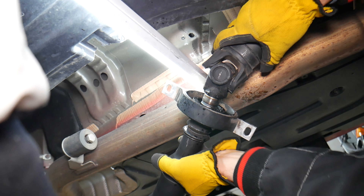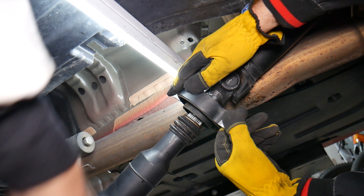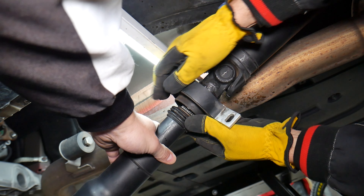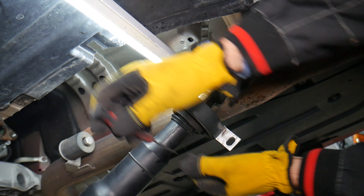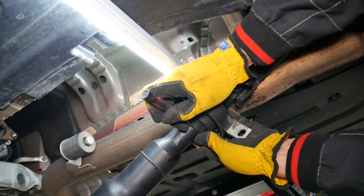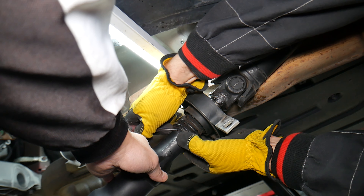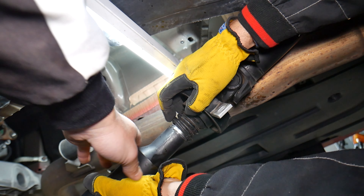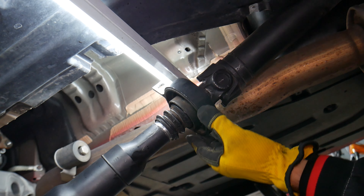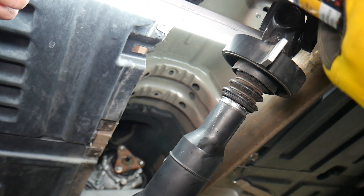There's the axle. The seal is right here. The two axle shafts should now come apart. We need to take them apart carefully — the seal has one lip it needs to jump over. There will be a washer here that comes out. It's a little stuck, probably has dirt in it. Apply a little PB Blaster and work it.